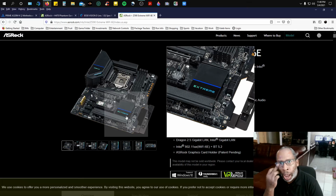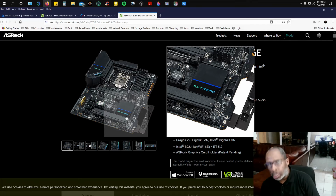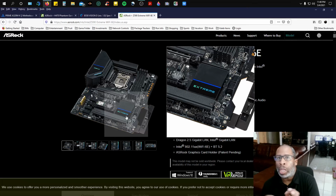Now, after you pick your motherboard, whether you are a basic, mid-level, or an extreme, you go with the case. A lot of people use Corsair because with those cases, you can pack a whole lot into it. That's the thing there. Understand your case. One, your case needs to be mesh. If there's no airflow getting into it, you are choking your parts. You are trapping your PC with a lot of heat.